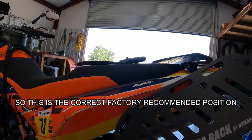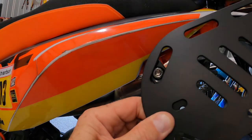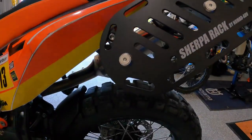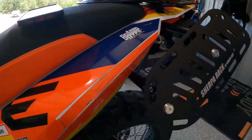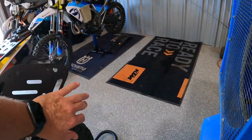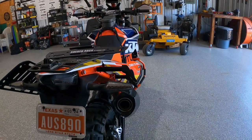These guys are going to go on — this hole lines up here, and this hole lines up here. You may have to move these around a bit to get them in the right position. The important thing is that you can still get to that Allen head on the top side once you have these bolts in. So that side is on, everything lined up so I could still tighten these afterwards — got them snug and everything tightened. Good blinker protection there. It is frame mounted, so I'm figuring it's going to be pretty strong. That's what it looks like from the rear on the offset — I'll do the muffler side and go from there.